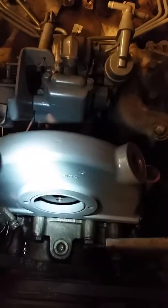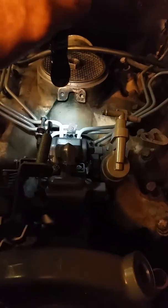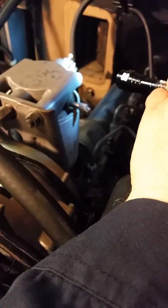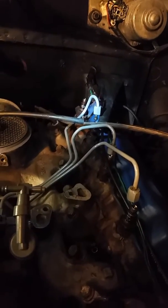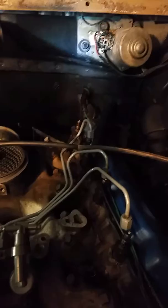To take it out without disturbing the gear, you have to unbolt the injection pump itself from these three bolts inside and the three nuts on the back — there's one and there's two on each side. Then you have to undo the back supply line that goes up to the fuel filter housing tower. I would also recommend taking off the rearmost fuel injection line that goes to the driver's side of the vehicle in the very back, because it will hit your windshield washer motor and your firewall.